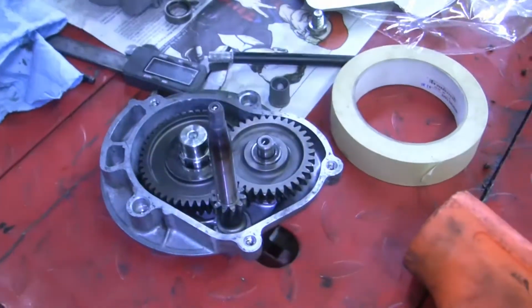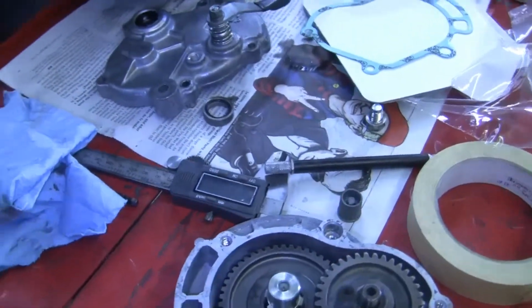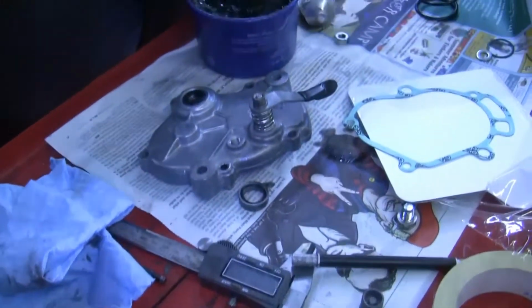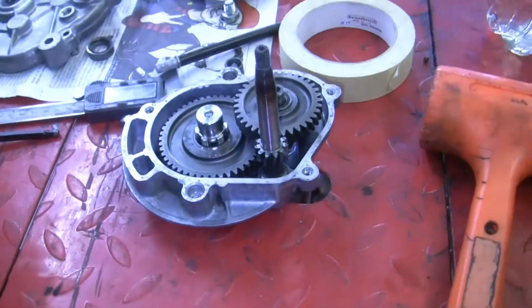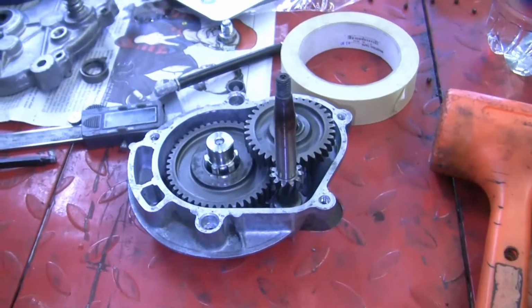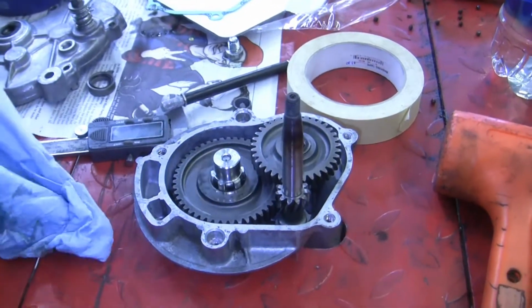But yeah, if you're just trying to get maximum speed out of one of these bikes, you just put like zero weight or like 10 weight oil, or even just use something really goofy like fork oil, like 5-weight fork oil, because it'd have just enough in there, plus it'll have all the anti-foaming stuff in there.